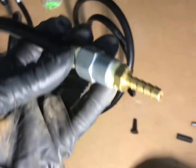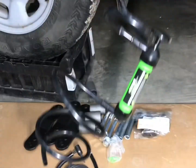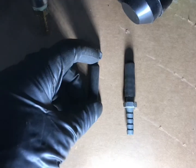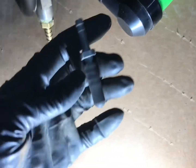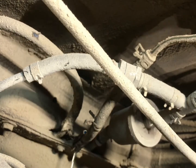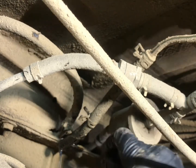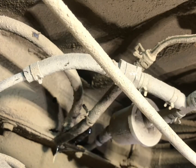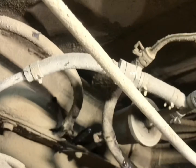Using a combination of male barbed ends and a female collar, I was able to reduce the fittings to the correct sizes for this cheap transfer pump I got at Princess Auto. Then using some female caps and the male double ends, I'm able to cap off the rest of the lines. I'm going to pull the main line, the return line, and the vent off here and cap them so that I don't get any diesel leaking or any smells in the shop while I'm doing this.